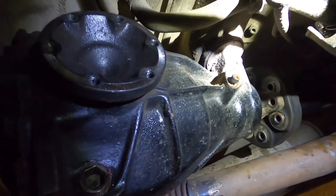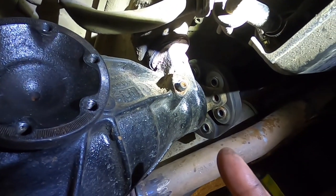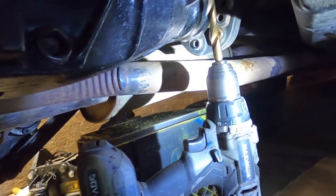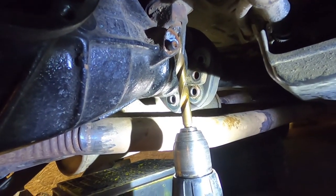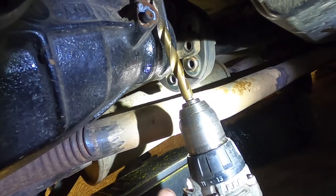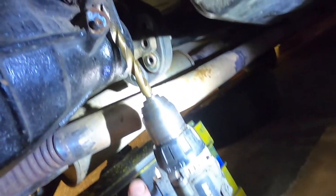I'm working on the differential removal. I've got the axles pulled, fluid drained, rear bolts broken loose, drive shaft off — I'm just working on that front mount bolt, but unfortunately it's stripped out internally. I just had to show this genius idea: my arm was getting tired of pushing on the drill, so — scissor jack. Drill away, just add a quarter turn here and there.